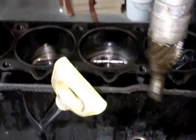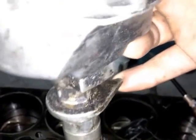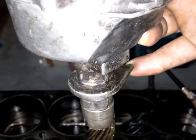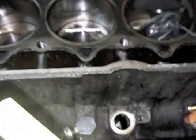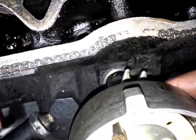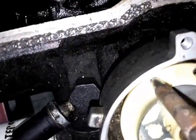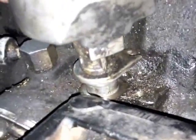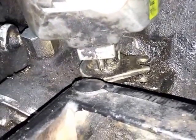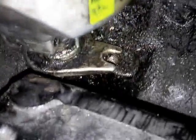Now you're going to take the whole unit. In the book it talks about this: the bottom plate of the distributor needs to be at the one o'clock position when you put this in. Go ahead and do that — that base right there is at the one o'clock position. Go ahead and insert that. As you turn this down, the entire distributor will turn, and when it lines up, you want it to line up just right with that hole where that bolt goes into your engine block.